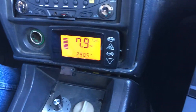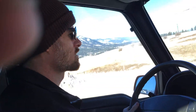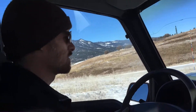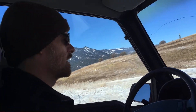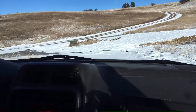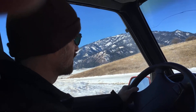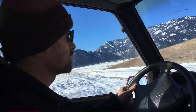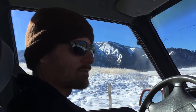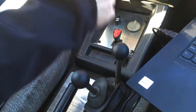On the display here you can see the percent throttle requested — right now it's only about 15 or 20 percent. And again, we're in low range so that speed reading is double. What we're about to do is what I consider one of the best features of this system — the regen. I'm at medium regen setting right now, which is about 28% negative torque, and I'm coming down a 10% grade on my driveway needing no brakes whatsoever. It's about to stop me dead at the bottom with regen alone, no brakes at all, which is really useful for an off-roader.